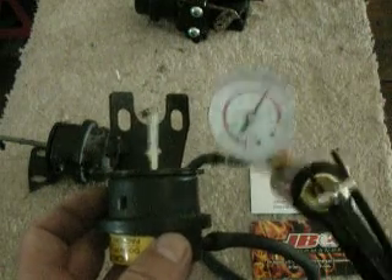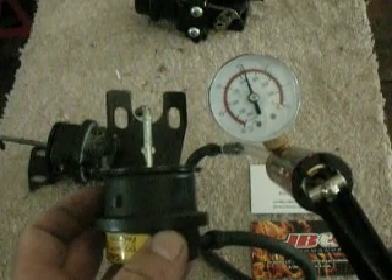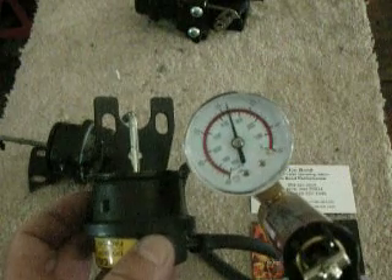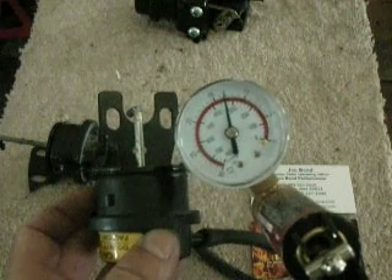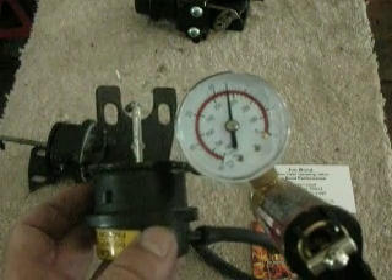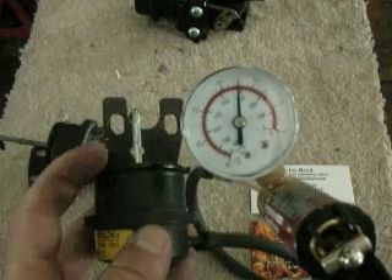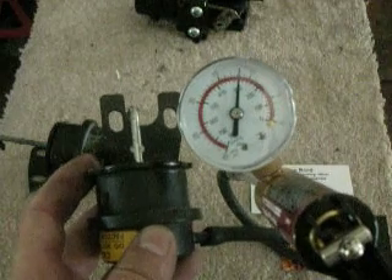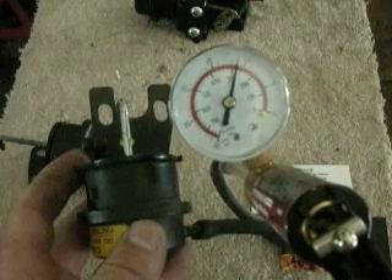Build up a vacuum here up to 15. It's working — it's functional, it's opening and retracting. But notice the gauge — it's dropping. The reasoning for that is this has a small pinhole in it. So this would be like a vacuum leak on your car. While this will open and retract functionally, it's not going to work properly on a car simply because you have a vacuum leak.